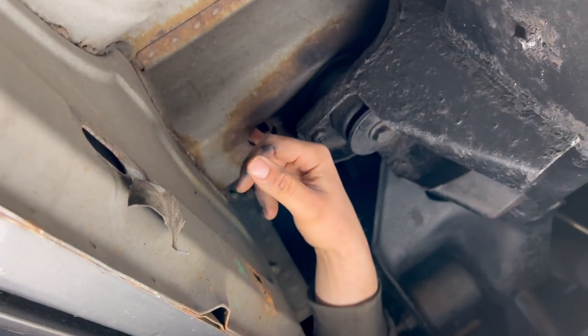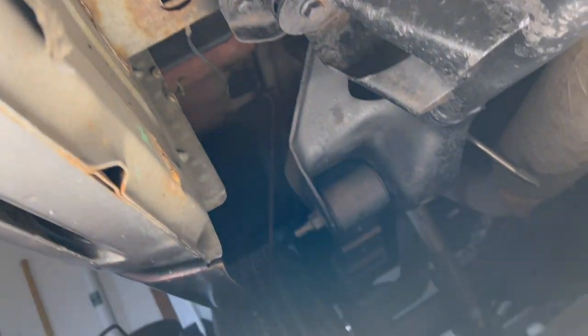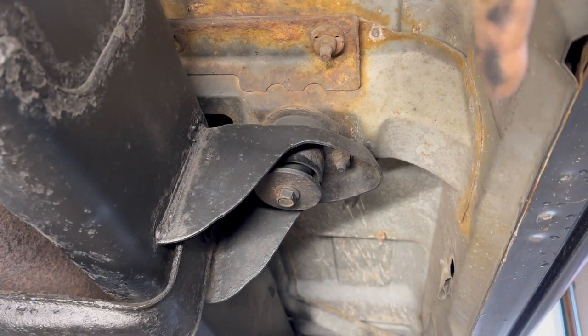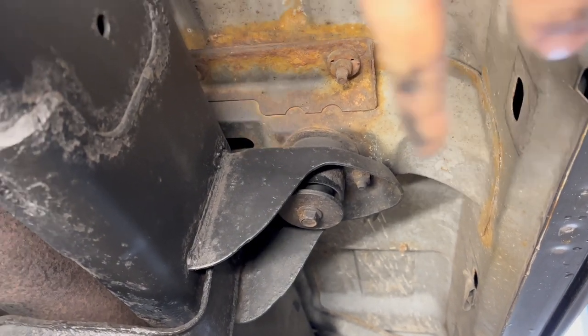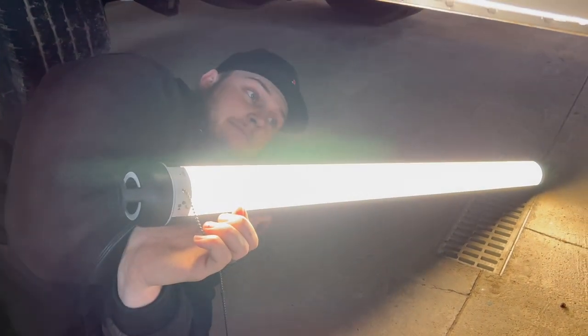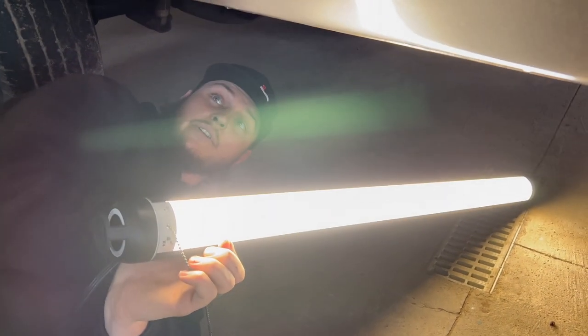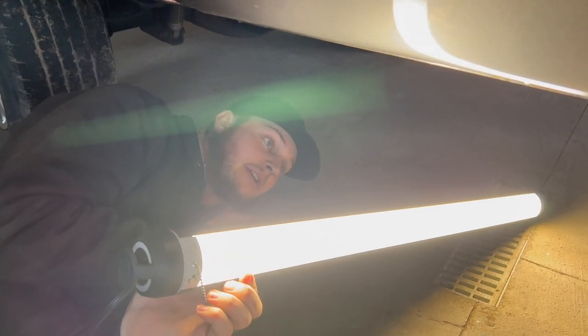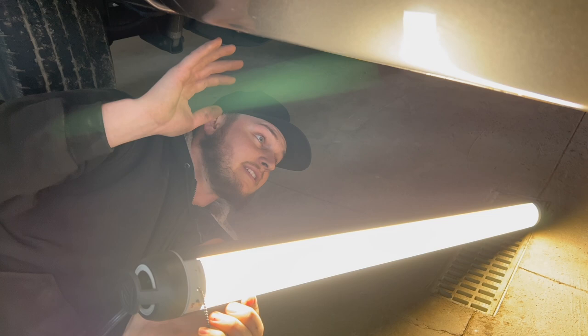Same with all these holes up in here, any holes in the frame that are factory. Like the holes up around the cab mounts too, if you wanna see those. Like the hole right there, the holes in there. Fill any of those holes you can get to with oil. Coat your floorboards. I mean, just fill any holes you can with that fluid, oil, transmission fluid, all that type of stuff. Again, be safe with how you dispose of it or let it drip, because you don't wanna do anything hazardous and hurt anybody or hurt yourself with your water sources and stuff, or your animals.